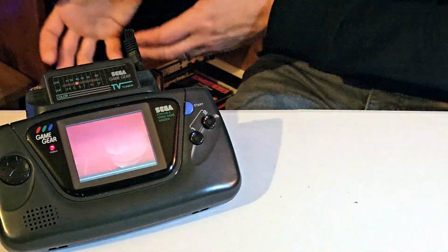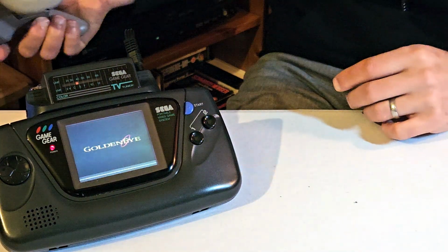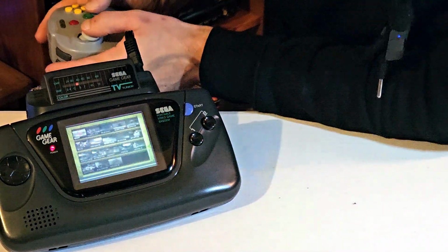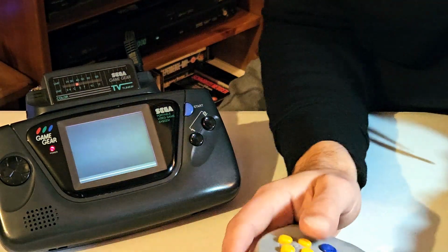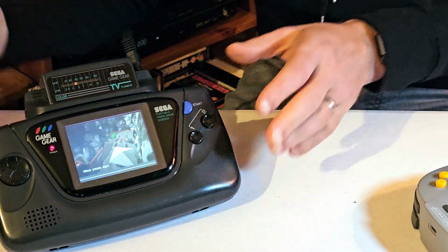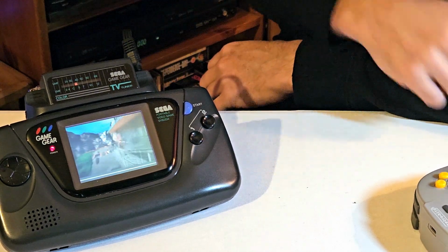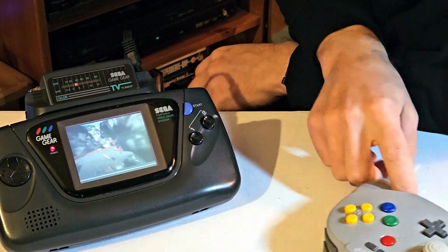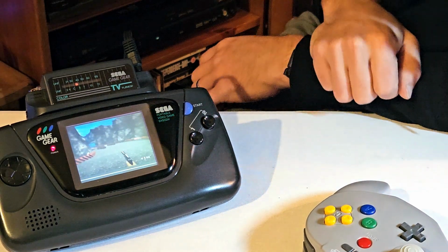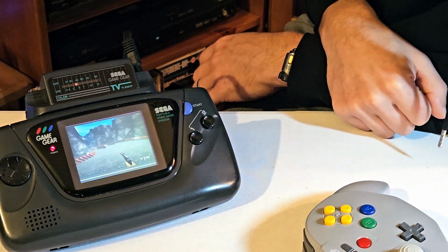Similar to the RF, again, if you're holding a controller, or in this instance I've got one of the aftermarket wireless ones, you could just play the game. So you can see here, I can't really see what I'm doing at the minute, but I could just use this as a monitor and be playing the game. So that's method 2. It gives you a sharper image than the RF. You will need, again, a specific adapter, and then of course a composite video output as well. But yeah, another pretty good wired solution, and that's covered off both of our ports on the adapter. So why don't we move on to method number 3, in which we start to use wireless options.